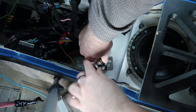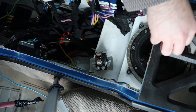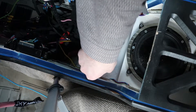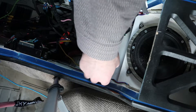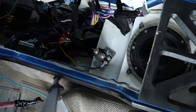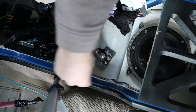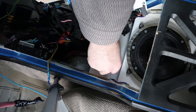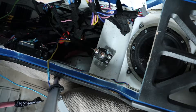When this went out, it was causing the alternators to almost turn on and off. You can feel the alternators drag on the engine, then kind of not drag, then drag again — back and forth. That's what told me something was wrong. Now I'm going to replace it with a new one. This one is very old — I don't even know how many years I've had it in the car, but it's been quite a few.